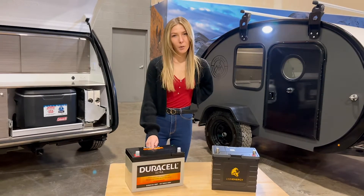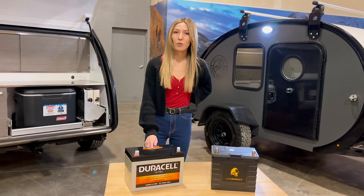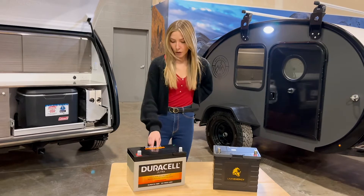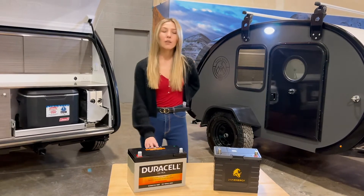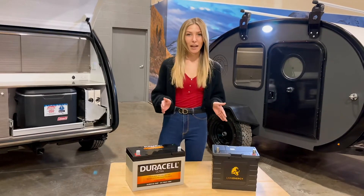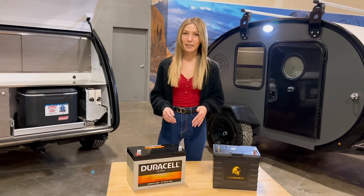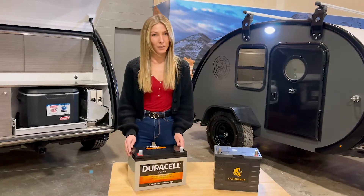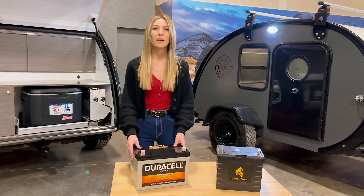You want to make sure with this battery that it doesn't get below 50%, as that can become detrimental to the battery life. During the winter, you'll want to keep it on a maintainer — it's only going to give it as much power as it needs, keeping it at 100% charged, because AGM batteries can and will freeze during the winter, so this is very important.